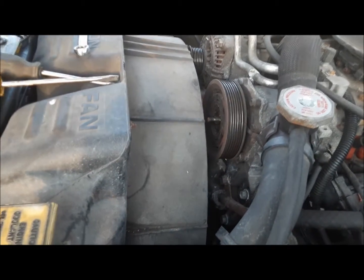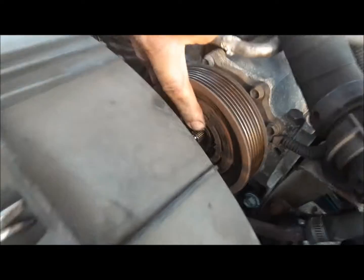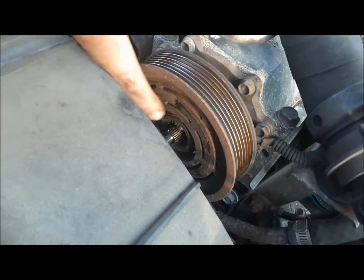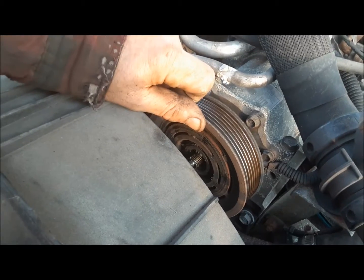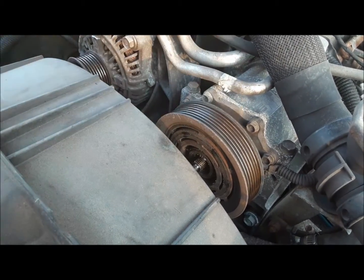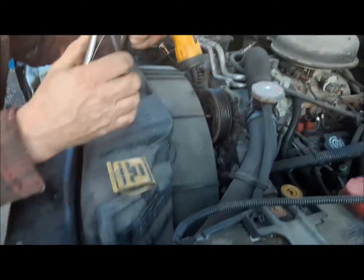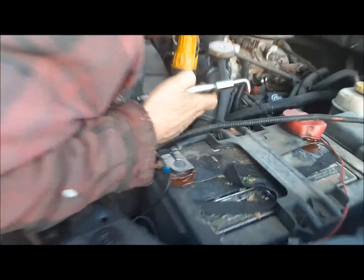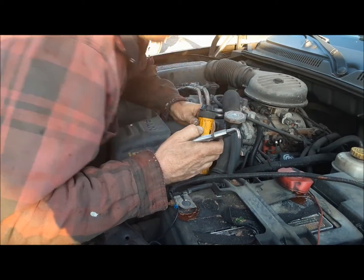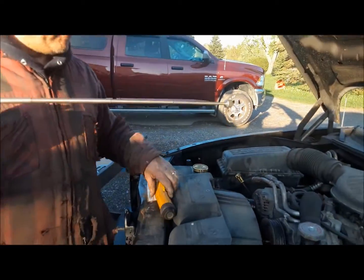Now there should be — I can see it. It's hard to see in there, but there's a snap ring that holds this piece on. So I'll get in there with a snap ring plier and get that off, and then that'll get the pulley and what's left of the bearing out. We managed to get the snap ring off and drop it — lucky for us it was way down there. Let me go get my long magnet. There it is; we'll hang on to it for now.